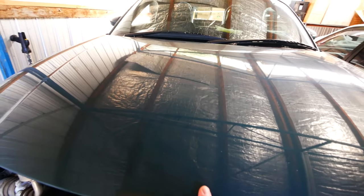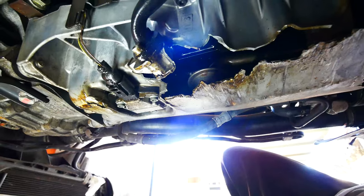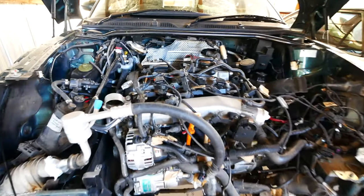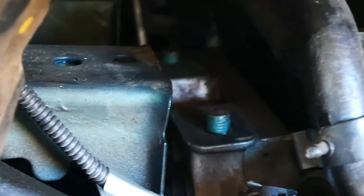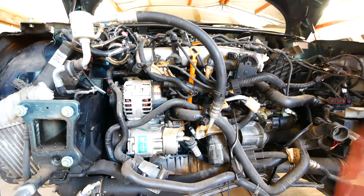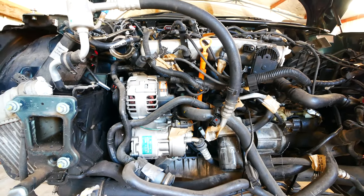Looking at it from the front, we can definitely tell it's all a mess. In the previous video I showed you that crack and you can really see how bad it is. The car felt really low, and this is why — the engine doesn't sit properly. If you look closely here, this mount has dropped significantly because something terrible has happened there. It looks like the two bolts have failed, making the engine drop down really low, putting stress on the dog bone mount and the engine, and ultimately having the sump hit the ground and causing that massive crack.